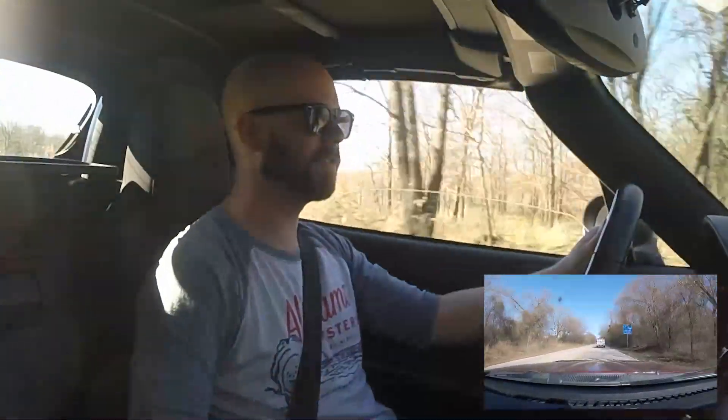You can just feel less of a flex in the entire system, and you get a little bit more feel from the rear end. You can kind of feel the car a little bit better because that vibration and traction comes through the power plant frame, up to your front wheels, through the transmission and your drive shaft. All around it just tightens up the front and the rear — it kind of connects the two a little bit more. Feels really nice. The car feels really, really good.